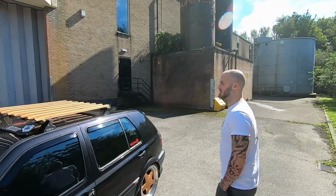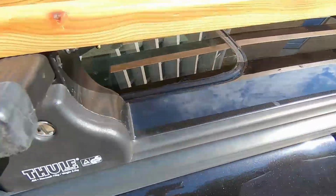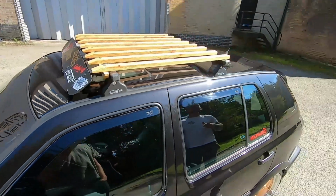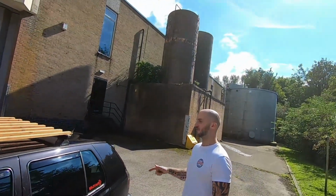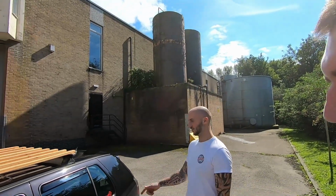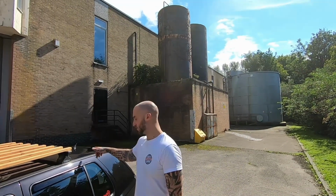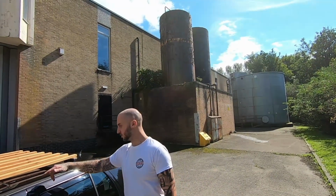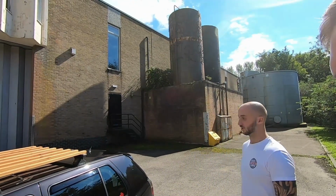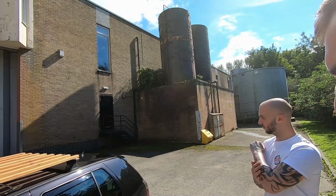Luckily it's got a sunroof as well, but I'm sealing it shut now because it never opened, and the first time I opened it and kept it open, one morning I came to drive to work and there's a swimming pool in front of the car. I checked the gutters and everything, they were all clear, and then sat in the back, that's why there's no roof lining in it either, and looked through and you could see daylight, didn't matter what position it was in. So I was just like, right, I don't use it anyway, so I loaded sealant in it, and it doesn't leak now.